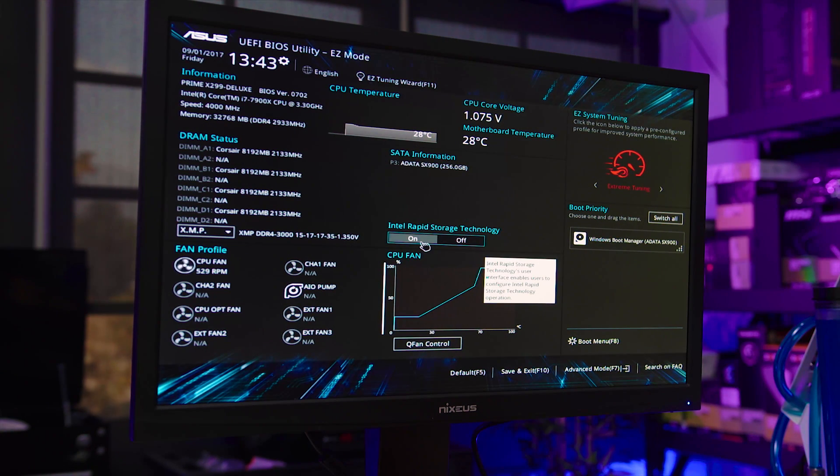That's why you're getting even better speeds than a traditional SSD, at least in our testing configuration. There was one quirk during installation: I was accidentally installing the wrong installer. Following the links, they say to use the setup_optane_memory.exe file, but there are several different installation suites and they all have the exact same file name, so I didn't catch it until later. Once I got the right one, it was pretty simple — it reboots, makes sure RST is turned on in your BIOS, then asks if you want to accelerate your system with Optane. You say yes, it reboots again, and you're good to go.